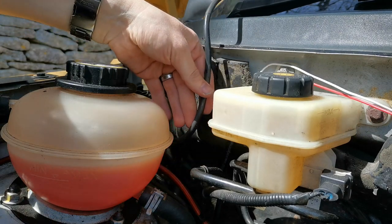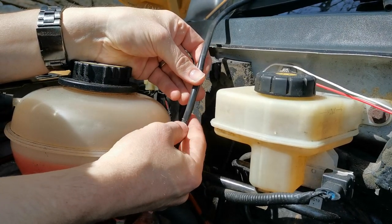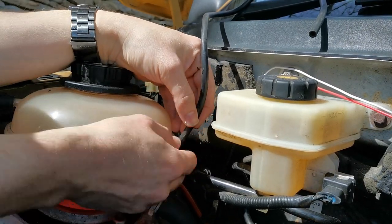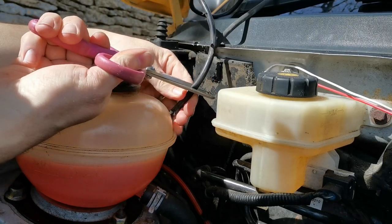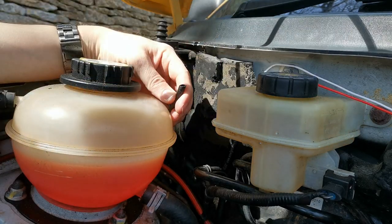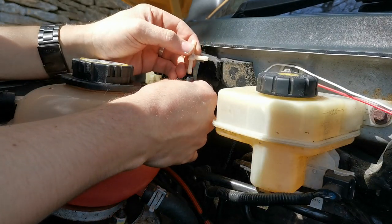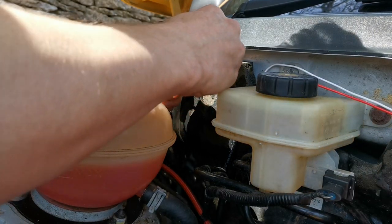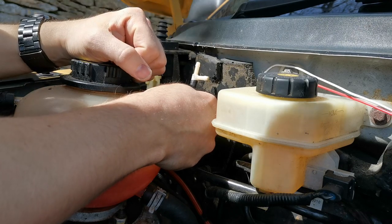Okay, so my washer pipe came up in behind the coolant tank here, and there was actually a split here which would never be helping, so I'm going to cut below that — quite a bit below that — and restart my join there. So I'll lift this up a little bit — there's the split — just snip it like that. There might be a little bit of residue from the leftover fluid, but that bit's out. And then there's my little T-piece — this is the one that was rigging up on the bonnet — should hopefully fit down into here. Same size. There we go — that's the first join in. So let's now just attach the rest of the pipe.